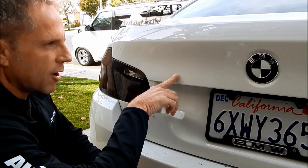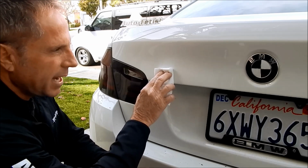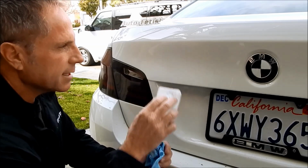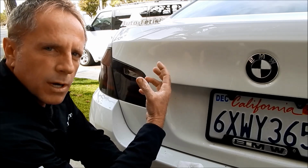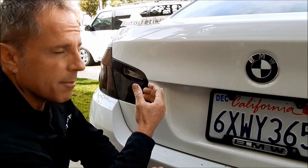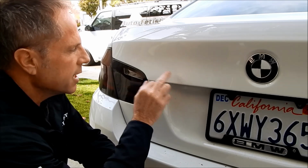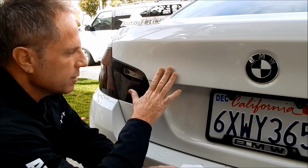Now I know because of the age of this car, I'm already going to have to polish it. I've already accepted that at the beginning. So if I abrade this paint, it's a non-issue to me, because literally scratching the paint and abrading the paint are two entirely different things. Abrading it literally just scuffs the very top layer of ultrafine, what in the industry we might call micro scratching. There's another over-glorified word, micro scratching. What does that mean? Well, it just means you're scratching at a microscopic level. It's not individual deep scratches. So abrasions, to me, a non-issue. They're easy to polish away, whether I'm going to do it by hand or not.